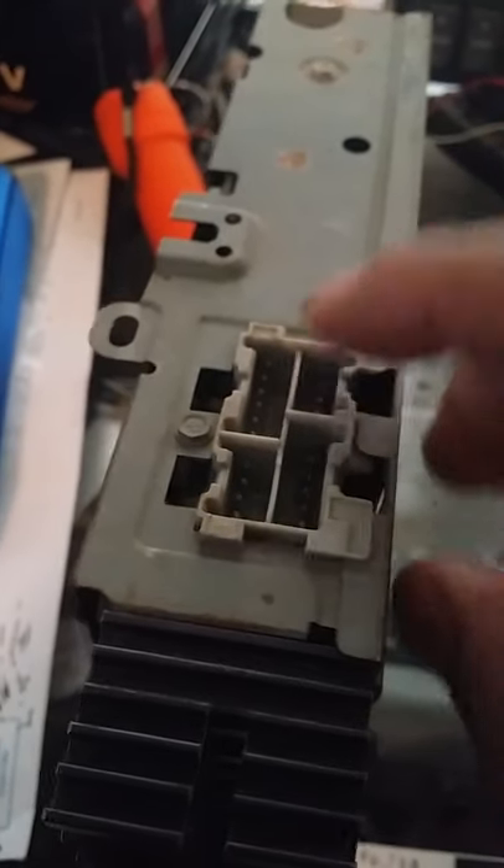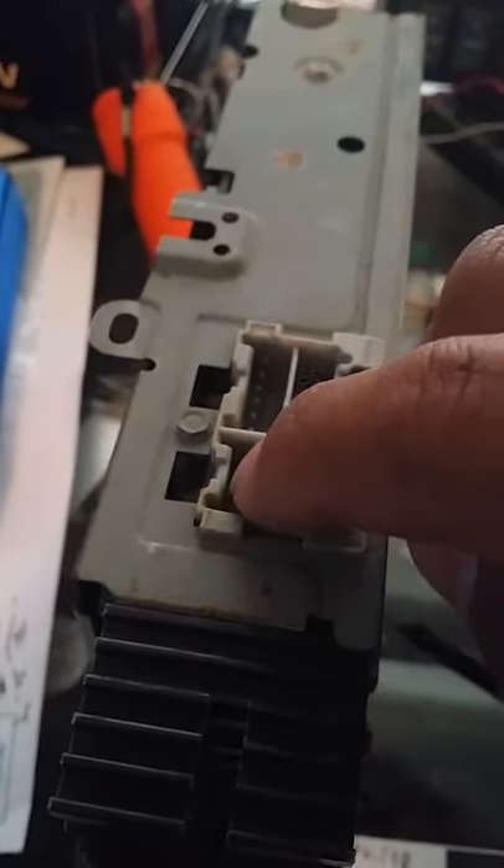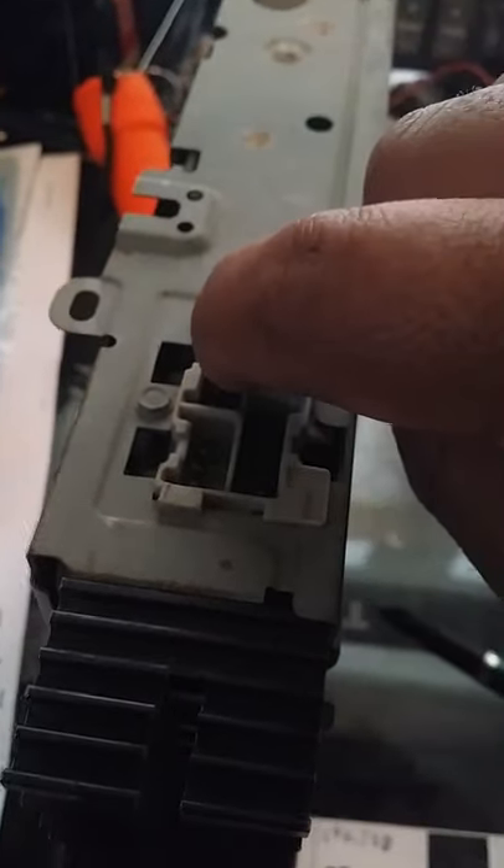You have your rear speakers, front speakers, that's your power and all that stuff. You have your orange and white — orange is hot all the time, yellow is on and off with the key. Of course your black is your ground, got tied to a battery power supply.